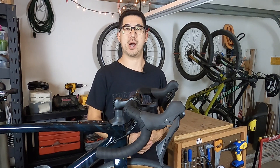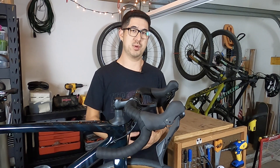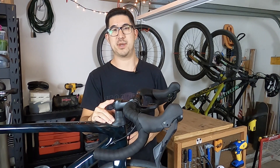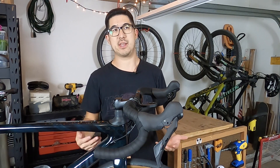The Future Shock suspension system was introduced by Specialized on the model year 2017 Roubaix endurance bike as a means to smooth out the rough roads on the infamous Paris-Roubaix cobbled course. It uses a cartridge spring unit mounted inside of a proprietary fork steer tube to provide the rider with 20mm of axial compliance. The obvious drawback is that you can't use a Future Shock with a standard fork. The actuation is placed above the head tube, which claims to be better than a traditional suspension fork as it eliminates pedal-induced bob and generally weighs less. Because all the suspension action happens above the head tube, the bike's wheelbase remains constant, which in theory makes the handling more predictable.